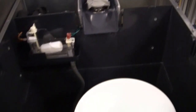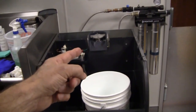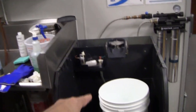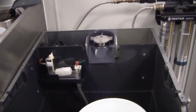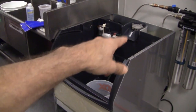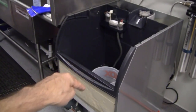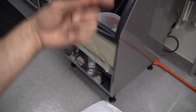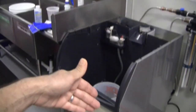It's going to take at least 20 minutes for me to start harvesting ice, so I'll sit in this condition for 20 minutes, start to harvest some ice, use all of this sanitizing solution here to get a couple of bins through, then go back to normal operation and purge this out. After that rinsing stage, I have some clean water in that bucket — I'm going to rinse the machine out, put my shop vac on that evaporator drain line to get fresh water through the system, and then go to normal operation.